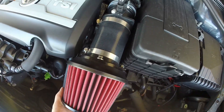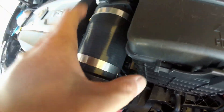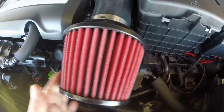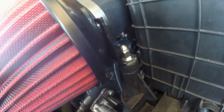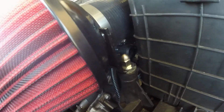I like my clamps on this side for this intake, and the only close spot is the hose right there. What you can do is swivel your intake up and down on this bolt and you can actually raise or lower it to get it in just the right spot. I got everything tightened — this is actually more solid than the P-Flow, and you're still using your rubber isolator just like the P-Flow. Simple L-bracket: you get that piece of eighth-inch thick aluminum bar at Home Depot, it's like a yard long, you just cut it, bend it over a little two-by-four piece of wood with a mallet, and then just pick your heights.